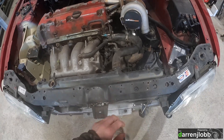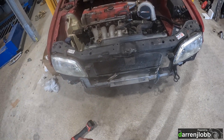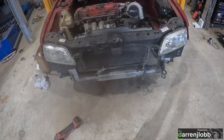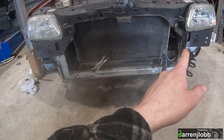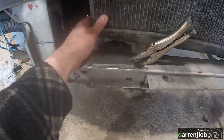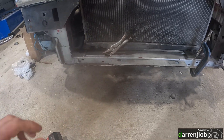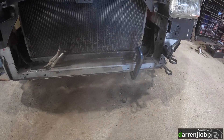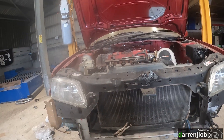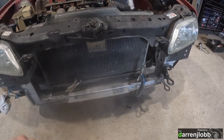A couple of reasons: number one, I find when you transplant engines, if you keep the original cooling package with the engine everything just works better - you can use all the factory hoses and everything is in the right place. If you put a Peugeot radiator in here the hose comes out the bottom because it used to go around the back and you'd have to adapt it. So you can see I've got it just dropped in there now - it's a bit tall, it's narrower than the Peugeot one, which is actually beneficial as it gives us loads of room for intercooler pipes. The bonnet does close right now but if I put a radiator cap on it, it's going to touch the bonnet.